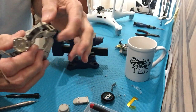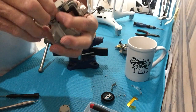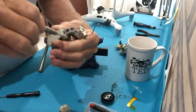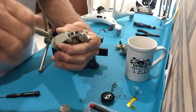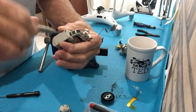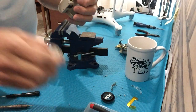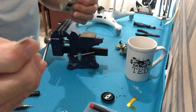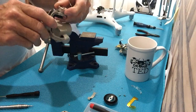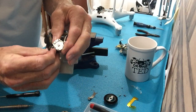I don't normally fully assemble this for testing. You do have to put this cover back on — if you don't put this on, you can't read the hall sensor properly. So I always put that back on, but I don't put any of the other covers on until I've tested it and made sure it works and there's nothing binding. For test purposes, I leave this cover off and I don't put this other cover back on either. But you do have to get this hall sensor piece back on.